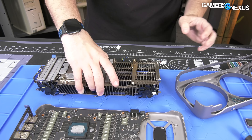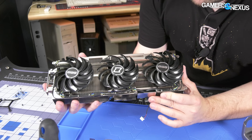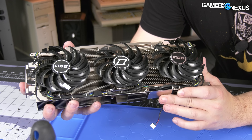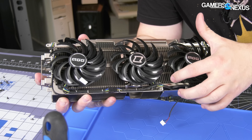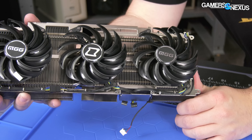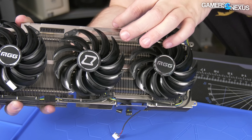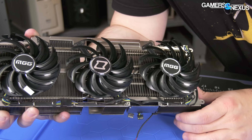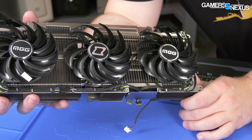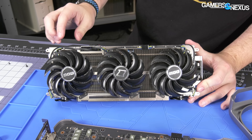We're separating the shroud and the cooler for a better look. There are seven heat pipes in there. I'm also now becoming more aware of some of that thermal performance we were seeing that was curiously a little lower than it deserves. It's also going to be because of the fin density — the fins are not as densely packed as you'll see on some other coolers on the market. Internally they've got additional spacing and some mid or quarter-height fins mixed in there. That may explain some of it — it's a lot of metal with good quality contact patch, but the fin density is a factor.